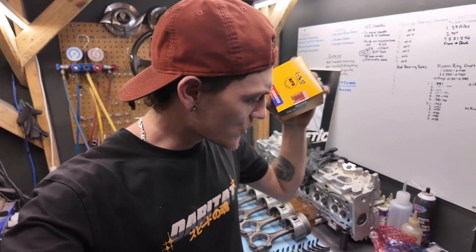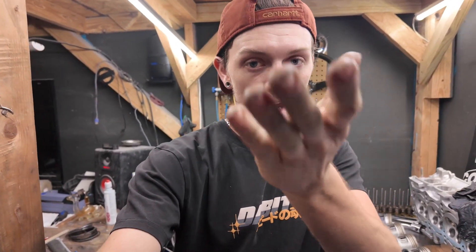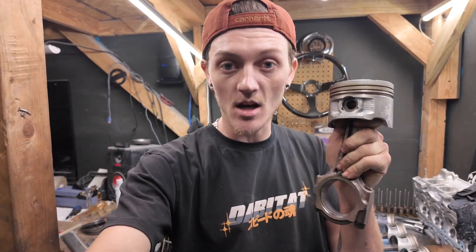It's time to put together the 2JZ. Last week I attempted to put together the 2JZ bottom end, but the piston rings that Hastings sent me were so far out of spec I couldn't use them. So I had to go with the tried and true NPR rings. I waited a whole extra week to get them, but now they're here. I just finished specking them out in the cylinders to confirm they're the right specs, and they are. Now it's time to put them on the pistons and install the pistons into the block.